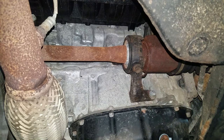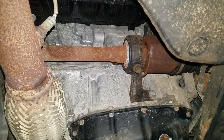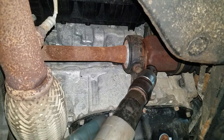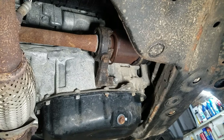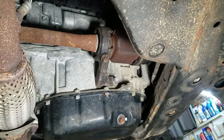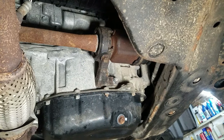That came out amazingly enough. I don't have any faith at all that this is going to come out but I'm going to give it a try — I'm just going to use an air hammer on it. With my hand it doesn't move; the thing's rusted in just like the rest of them. The joke's on me. You read a manual on how to get this out, but when you're in the rust belt and this thing's over 10 years old, it isn't what it is. If I take a torch to it, I'll just take the chance of wrecking the bearing in the axle. I can't take these bolts out and slide it out either because there's pins in here and it won't allow it to come out.